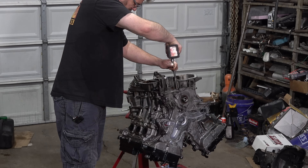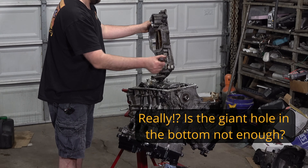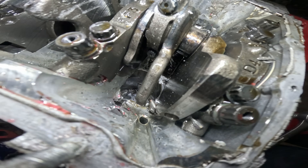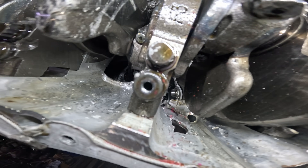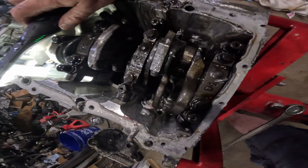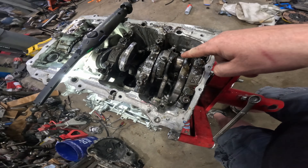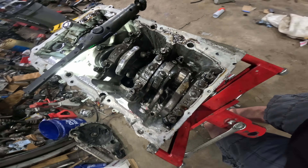Even this part's not usable — we've got a hole right there. It looks like we're down half the pistons. Number four is dust — we still have the wrist pin down there. Number five is still mostly located there; there might be some interesting data on the top of that piston if there was massive detonation or something. And number six — number six is just dust. This one's free spinning and that one's completely missing. The fact that it's completely missing might also be a sign — if it didn't get assembled properly and worked its way loose, it could be a problem.